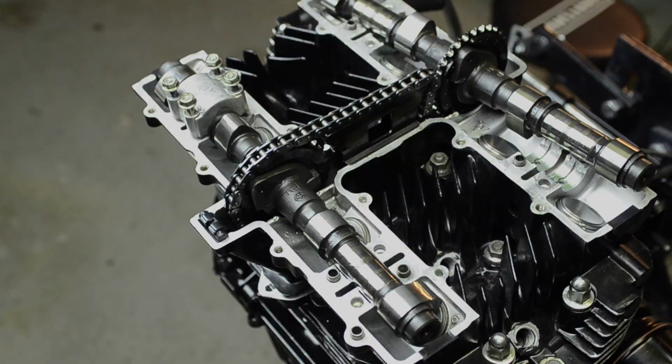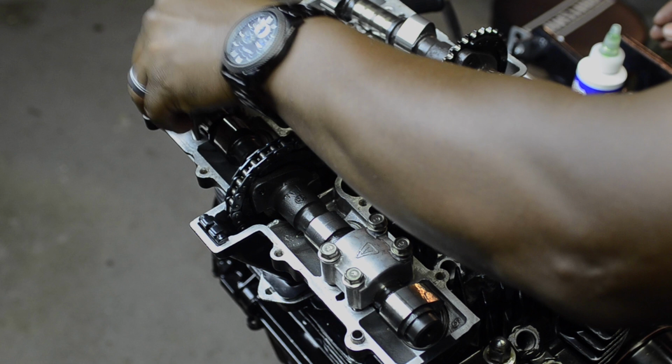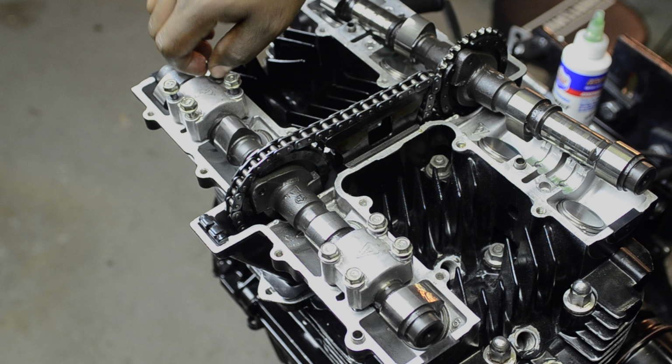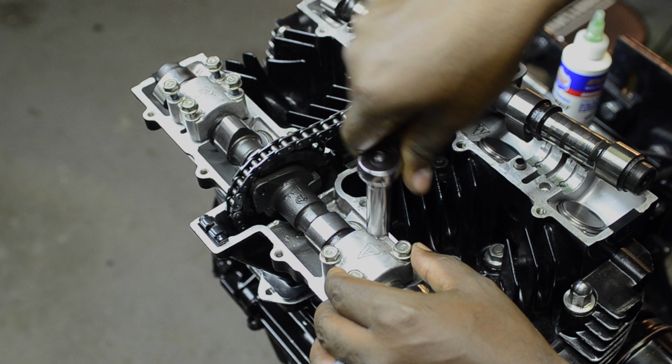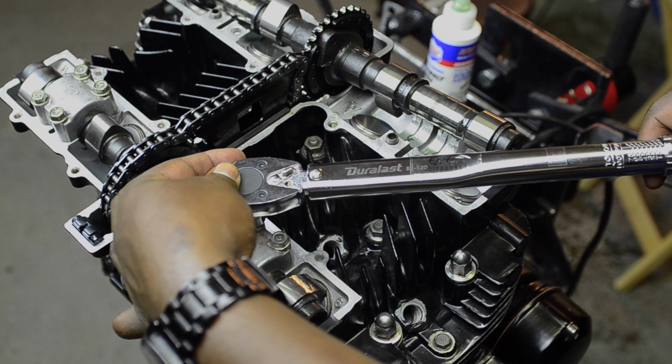Now I set the exhaust cam in. I think number 1, as you'll see in that previous clip, was pointing towards the front. Had to line that up. And then once I got that set to the correct place, I was able to put these cam holders, whatever they're called, the little clamshells, in there and get them locked down, so that the exhaust cam wouldn't move, and then move on to setting up the intake cam.